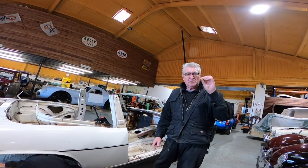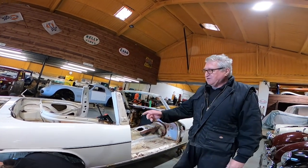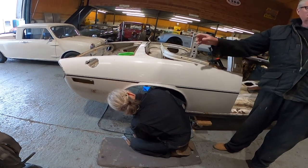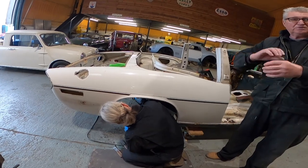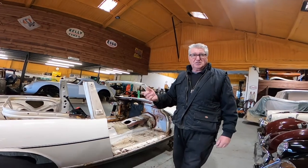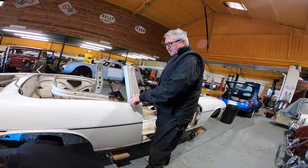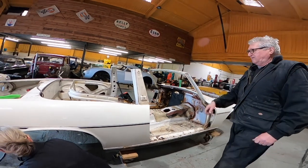Obviously over a period of time, some of it would just weep through or evaporate. It's similar to an XJS or XJ6, where people don't think about rodding the petrol cap recess — there's a drain pipe there, and if you don't rod them through, that's why XJ6s rot the floor pans. That drain is in there to drain the water. Like Mercedes SLs — they all rot around there. That's worth knowing.